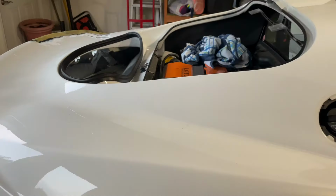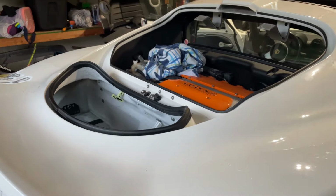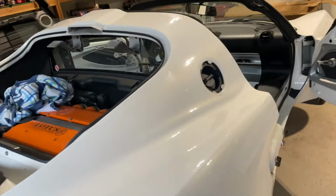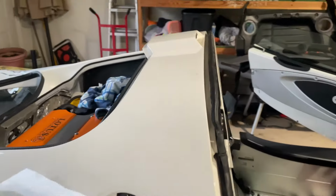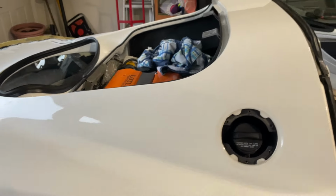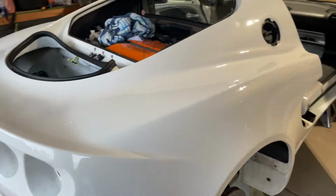We are in the home stretch now, guys. So each side of the wheel well, there are 2 bolts holding this lower rocker panel to the clam. We got to take these 2 bolts out here. That's it, guys. After those bad boys in the wheel wells, that's it. This clam is off. You can see this. All that hard work paid off. Clam is ready to move. So I'm gonna have to get my wife out here again, help me take her off.